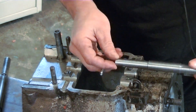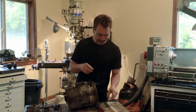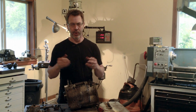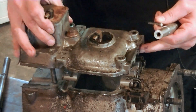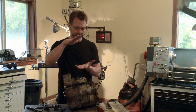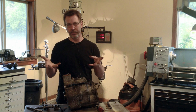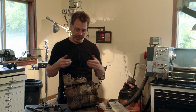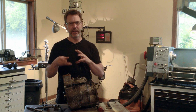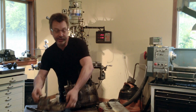We'll put this on the milling machine, slowly lower it in, and it'll scoop that out. So we're going to mount this all up on the milling machine and cut this out. One of the challenges is we have a clamshell, and we need to make sure that everything lines up because when this collapses down on top of that O-ring, we don't want to misshape the O-ring or we'll be defeating our purpose. So we're going to take this over to the milling machine, take some of the parts off, get it lined up, and see how it all comes together. Let's go to work.